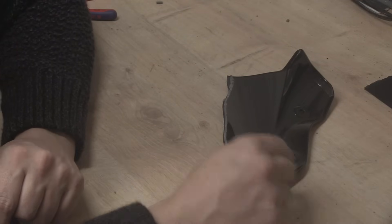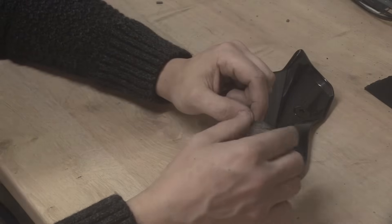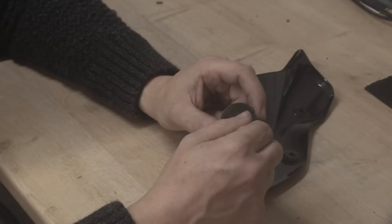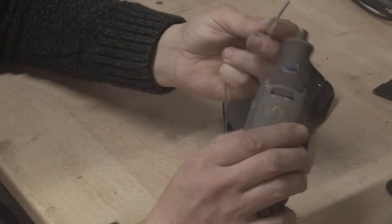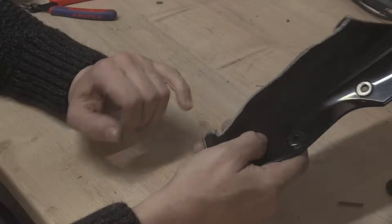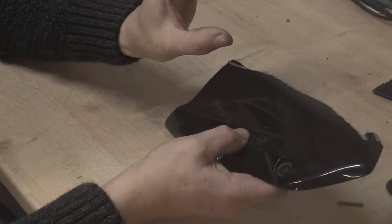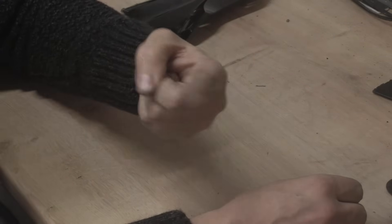This is a demo and food-for-thought. Someone might ask why not use a blunt drill bit and spin it to melt the plastic — it does gum up and turn nasty; I've tried that. You get really iffy results. The best results I've ever had are with almost 3mm filament in a Dremel — easily the best. If anyone has suggestions, put them in the comments. If enough people want to see it, we'll bevel this out and try again to see how good we can make it. I hope that makes sense, and I'll see you in a bit.